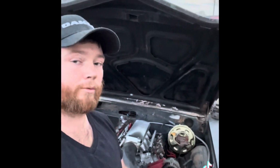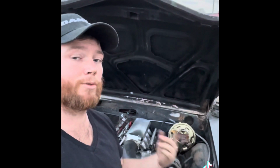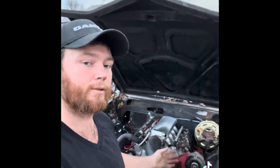You can ignore the 4L60 plug, you can tuck it up out of the way, you can cut it off, and you can tape up the wires. There's one in it that has power, and the rest of it is in the tune for your computer. You change it from 4L60 or 4L80 to non-electronic automatic, and it will still work perfectly for this.